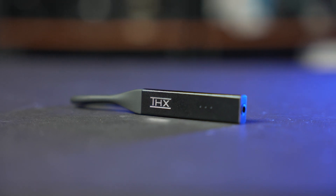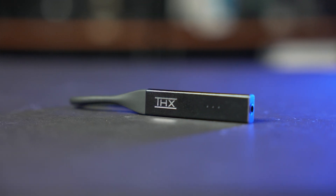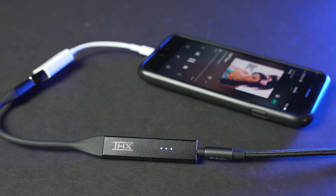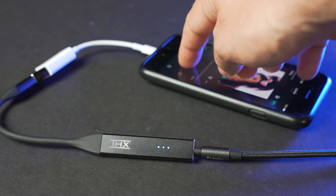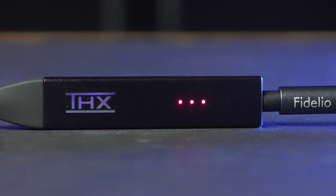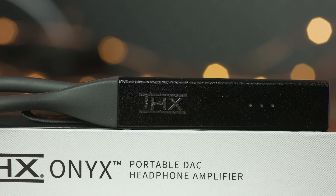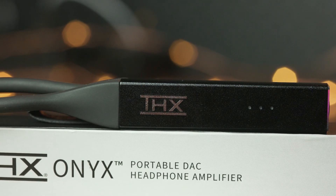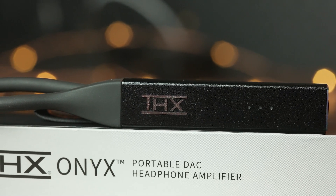So first off, what exactly is the THX Onyx? In an extremely simplified synopsis, Onyx is a DAC or a digital analog converter amp for taking a digital signal from a source and converting it to analog to send to a pair of headphones or even powered speakers through its 3.5mm jack. As a part of that conversion, Onyx can also decode MQA or Master Quality Authenticated Tracks. These tracks pack some extra information into the file and when decoded with a compatible device, produces playback that is studio quality like you are sitting in the studio with a recording artist. Onyx also works to play and improve any other audio as well and provides plenty of power thanks to the THX AAA mobile amplifier.